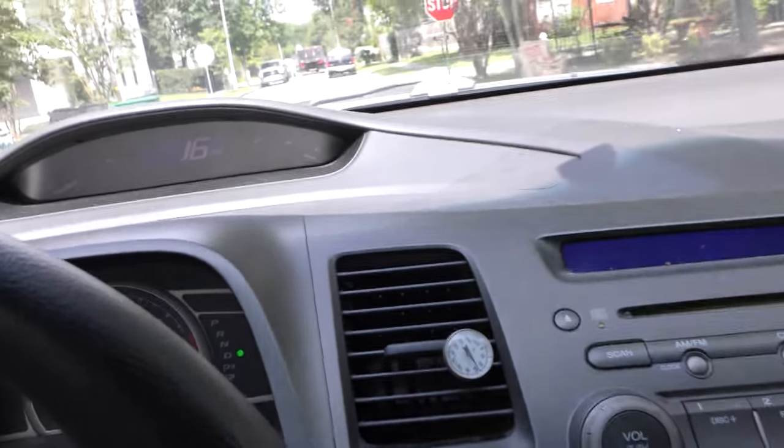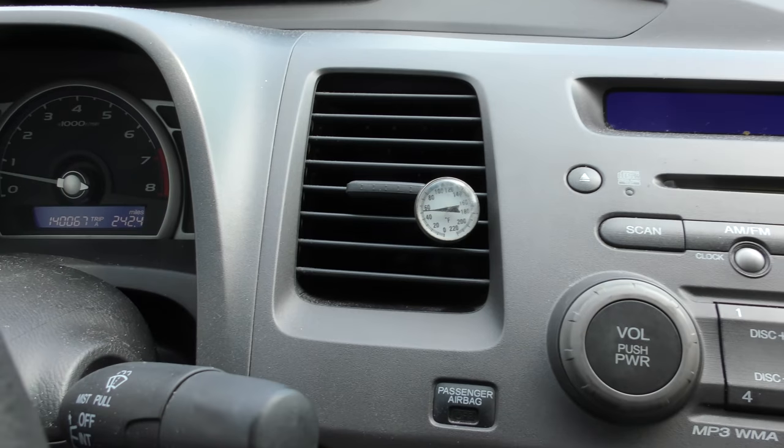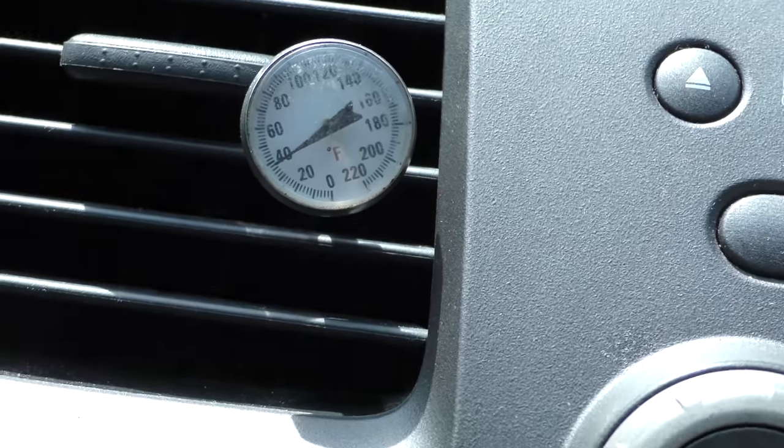It's already starting to feel pretty cool. After five minutes on the highway, the temperature is already down to about 42 degrees — you can't complain about 42-degree air, that's nice and cool. You'll notice while we're sitting it goes up to around 50 degrees, but once we get moving it starts going down again, closer to 42 degrees. That's normal for a car with 140,000 miles on it — the compressor is worn and no longer operates at peak efficiency. But rolling down the road it's even under 40 degrees, around 38 degrees. There's no sense in buying new parts — it's still blowing cold enough and a lot of the noise has gone away. We'll see how long it lasts before throwing over a thousand bucks at this thing.